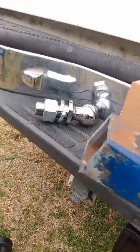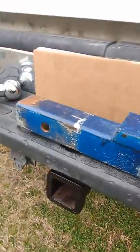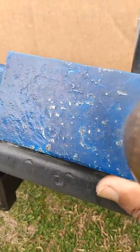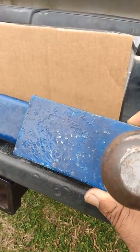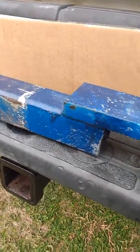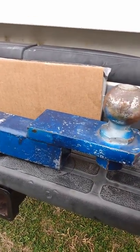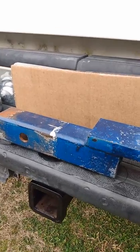You've got to really take care of your hitching ball, but I never had a problem with it — it never jumped off. I had very good confidence in this hitch ball. It's kind of heavy, you can see it's hollow, and it still feels pretty solid. It's got some good weight to it. And what is it rated? It's rated for 6,000 pounds. For a long time I thought it was rated for 5,000. But still, it's not rated enough to be super safe for what I'm towing — it should be rated more than what I'm towing.